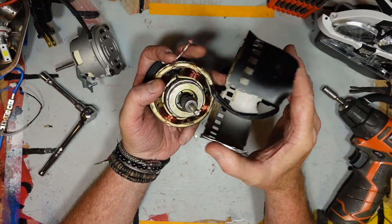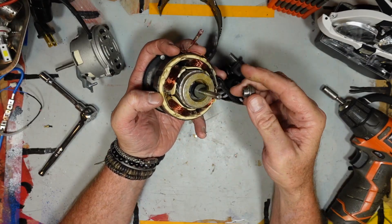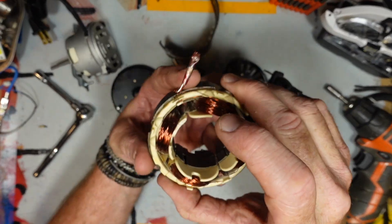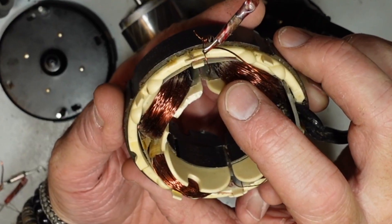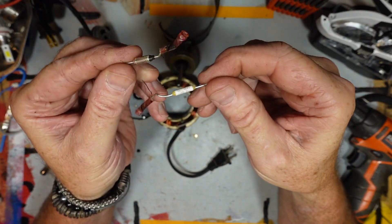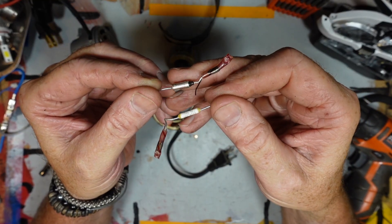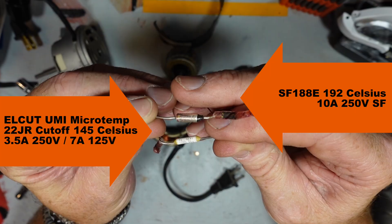Just last week, I was curious as to what had caused two bathroom ventilation fans to fail. So I took them back to the workshop and found they both contained thermal fuses which had caused these fairly simple, dependable motors to fail. These are not made to be opened up and repaired, but I did find two thermal fuses in each motor — one functional, rated at 192°C, and the other at 145°C, which had blown. For the technical minded, the fuse models are on the screen.